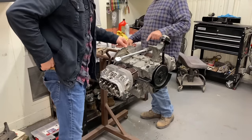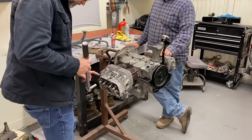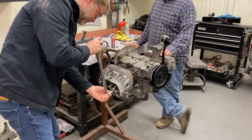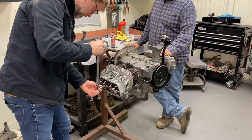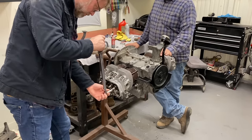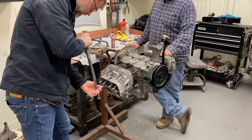That's impressive. Just go ahead and torque it up. Yeah, I've torqued the two rocker nuts. The rocker nuts, okay. And we're set to 18? Yes, sir. You're pretty much right on already. That was a little loose. Just go back and forth a couple times, check it twice. 18 foot-pounds, that's pretty much the standard for these?